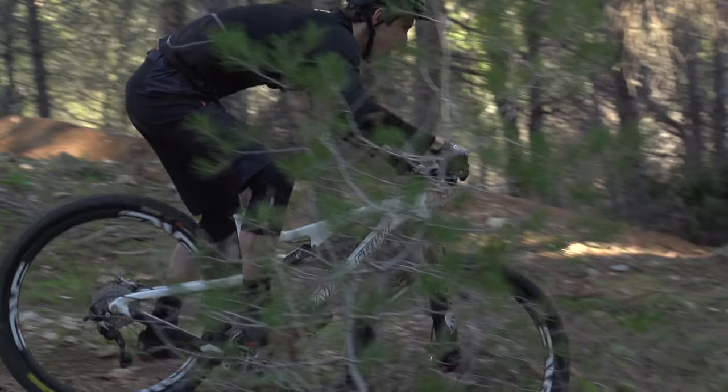This basically means it's really stiff and you can put a lot of force through the front wheel when riding down. So let's talk about wheel size. With 26 inch being the original mountain bike wheel size, things have changed quite dramatically in the last couple of years with the introduction of 27.5, which has probably become the staple wheel size across all disciplines. Then we move on to 29, which is really aimed at the XC market. If you are thinking of changing forks, you will definitely need to match your fork to your wheel size — they do not cross over; it will be a specific fork for your specific wheel size.